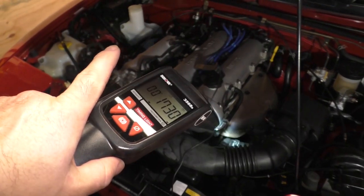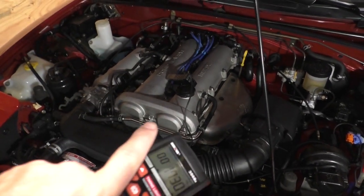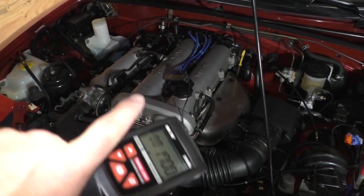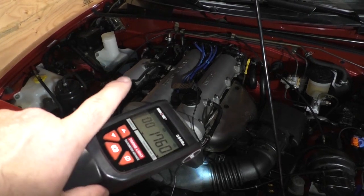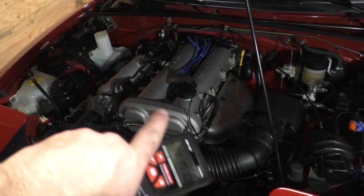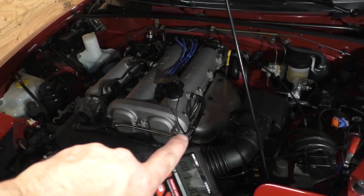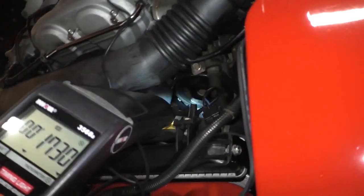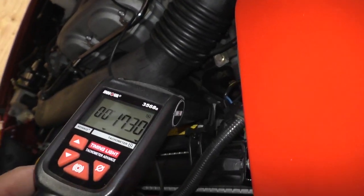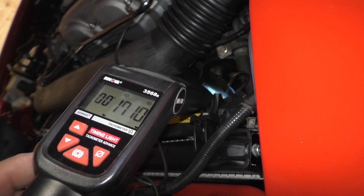The first mark is going to line up with TDC. The second mark behind it, that's the ignition trigger mark, and that's the one you've got to worry about. So the one that's forward of that mark is top dead center. That's going to line up with top dead center. So the factory recommended adjustment is already there for you. Okay? Sound good?